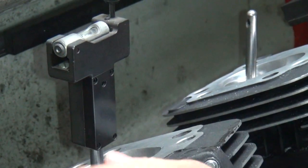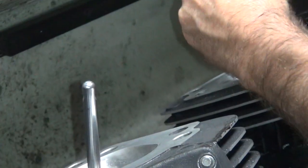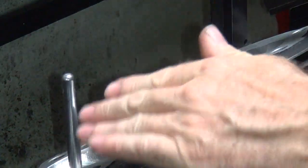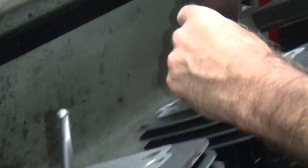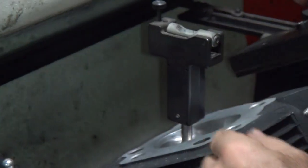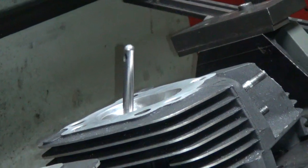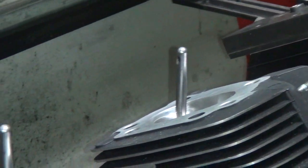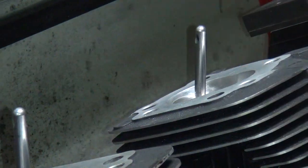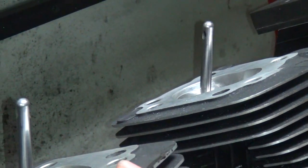It takes time to do things right. But you can actually individually do every valve if you want to. Your height will change every time you clock something — the height will change a little bit. It's really critical that everyone has to be exactly the same all the way across because it might make some weird difference. But the combustion chambers are all CNC cut anyway — who cares? It doesn't matter if it's off a little bit. You look at how these heads cut over here — they're not even close to being the same. Who cares? It is what it is. As long as it's closed, it doesn't matter.